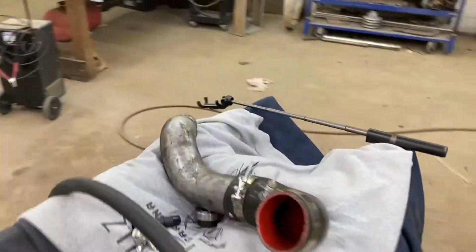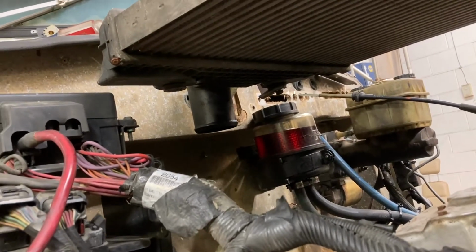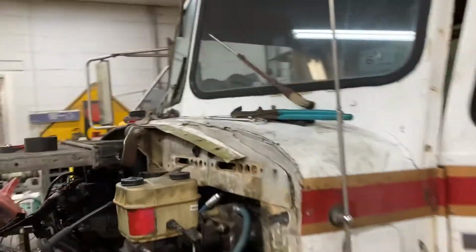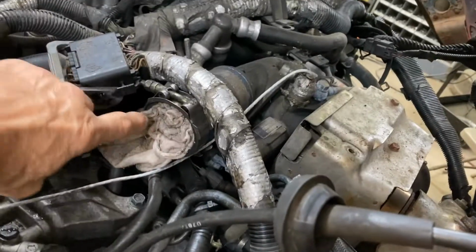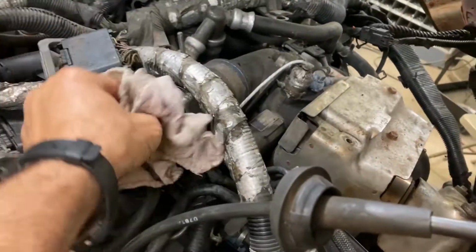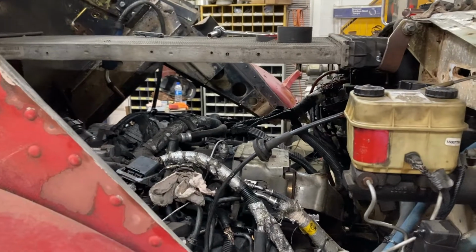And right now we started fitting up some tubes and modifying the tubes to fit. Turbo tubes. Want to go from there and elbow into the intercooler there, and then back there is another spout. So we'll come off of here down through here into this spout right there. So that's what we're going to work on first this morning, is just getting these tubes formed to complete that.